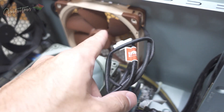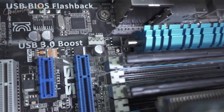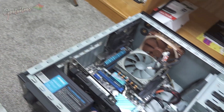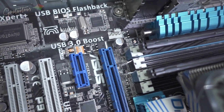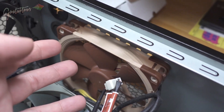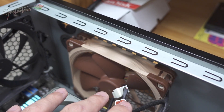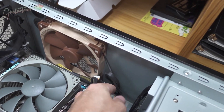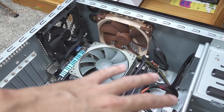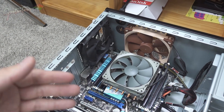These are called fan headers — this is where you plug in different fans. There's a chassis fan header labeled CHA_FAN1. If you're purchasing fans, make sure to get PWM fans; they're a little more expensive but so worth it — you can set your fan speed to whatever you want. For music production it's all about silence, so you can adjust your fan speed slower, adequately cool the computer, and give yourself a quiet machine. You can also adjust the fan curve.